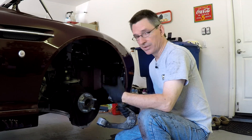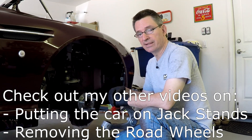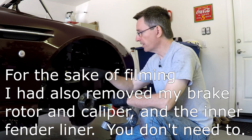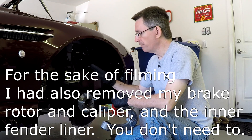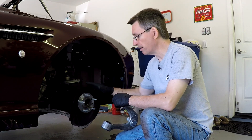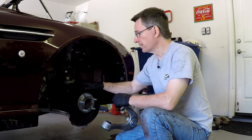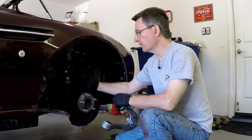Alright, it's time to get the upper control arm removed. I've already got the car up on full jack stands - you could do this just on a single point jack, one corner at a time. I've also removed my fender liner, though that's not technically required. And I've removed my road wheel and all my braking components - caliper and rotor off. You don't necessarily have to do that either, but I wanted to do it so it'll be easier to see what I'm doing, and I'm also doing a brake job right now.